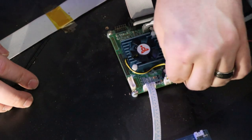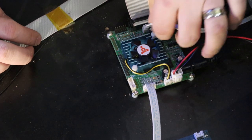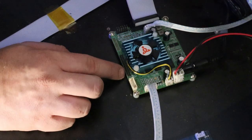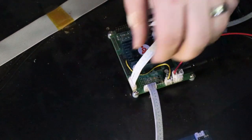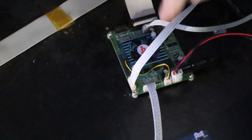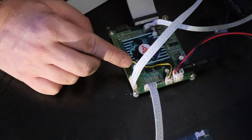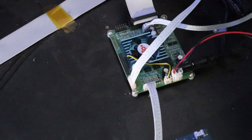At this point you're just going to plug everything back into its corresponding port. You have about four cables plus the black AC adapter cable, and then we still need to plug in the ribbon cable. Now this is important — the LVDS cable. You have to make sure that the red wires are pointed towards that white port, that way you have them lined up in the right position. If you flip flop it and the red wires are facing in the wrong direction, that's going to end up messing up everything. When you go to mount your monitor back on, make sure the red wires are pointed towards the right, towards that white cable.